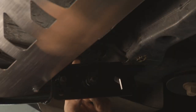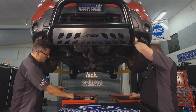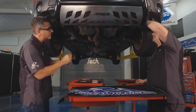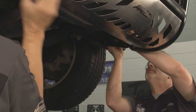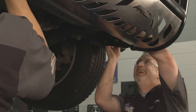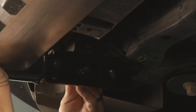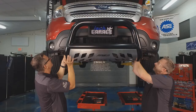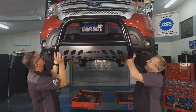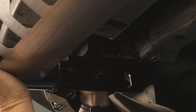Now we got this plate — why do we have this plate? Well, the frame actually steps down, so this is pretty cool. You can take this plate and use your nut with your lock washer, and then with your big bolt, stick it through there and hold that bolt in place. You put it up in there and that bolt will hold it right there so it doesn't hit you in the head. I made a little indentation here in the frame — maybe you can go up there and grab it.